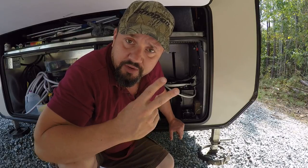So I hope this tip helps you out. Get rid of your 12 volt garbage battery. I wouldn't go to lithium if you're a weekend warrior — don't get lithium batteries because everything needs to be changed and it costs a fortune. We're talking $800 batteries; it's not worth it. Get the cheapies while they're cheap, because everything's going to lithium. Take advantage of the lead acid — get the true deep cycle lead acid batteries for golf carts, put them in at 6 volt, tie them together as pairs. You've got to buy two at once, and you'll be a happy camper. Trust me.